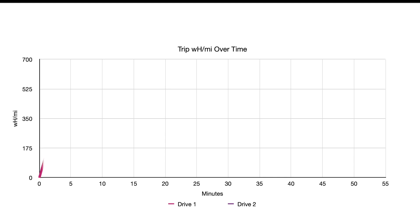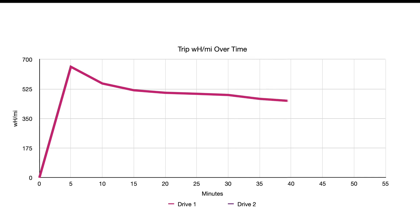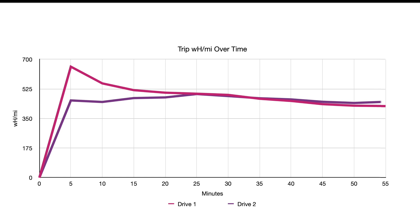We also have data from our average watt hours per mile through both drives. On our first drive, we shot right up to 657 watt hours per mile as the pack went from dead cold trying to warm itself up and propel us. Even though some of that early part was downhill, we weren't getting any regen, so it was having to do all the work. That came down into the 500s and then settled around the mid to low 400 range — still high for a normal drive, but it was 16 degrees out. Our second drive jumped up to only 450 watt hours per mile and danced around the mid 400s for the rest of the test. The temperature was 5 to 10 degrees colder than our afternoon test, so I expected this watt-hour-per-mile to be much lower since we had preconditioned. I'm assuming the difference at the end where the second drive goes a little higher is because of those colder temps.